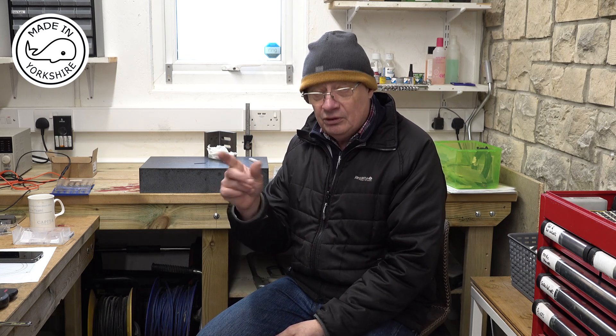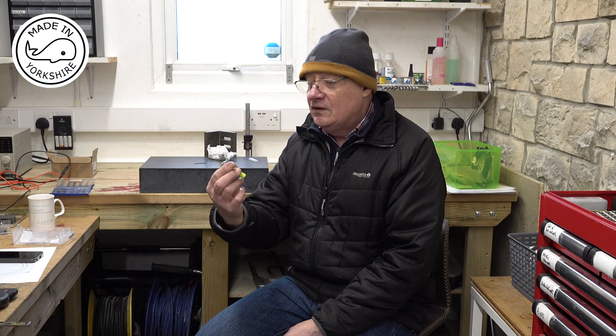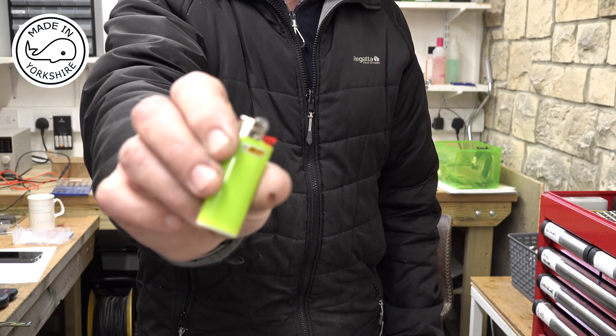One thing I was going to mention — this little engine's governor lever needs a really, really small spring. Somebody mentioned a great source for those: these little Bic lighters. There are a couple of springs in there of different sizes and one of them is perfect for going under that lever on the governor. Anyway, I think my next video is probably going to be making a fuel tank, or if I miss that one out, I'll be showing you the final product on a little stand, tidied up and painted. I hope you like the result and I hope to see you later.